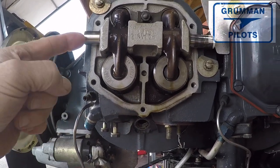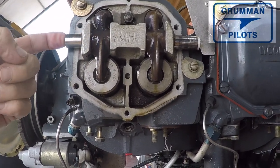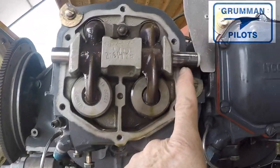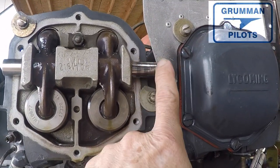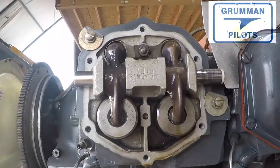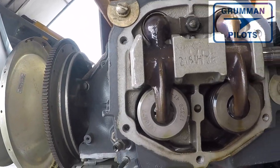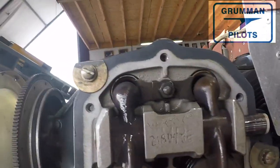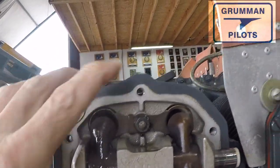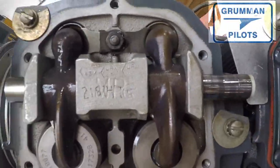On the left where the rocker goes through, there's a 7/16-inch Harbor Freight socket that fits right through the bore and allows you to retain the rocker arm while you move the pin out on the other side. Then you can remove one rocker, slide it the other way, remove the other rocker, and that allows you to pull out the push rods.